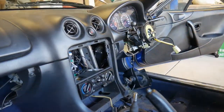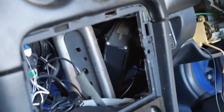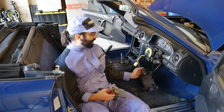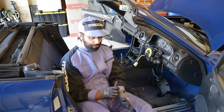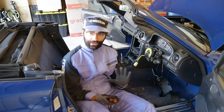The wiring for this cruise control is going to be a pain. If you have a look deep inside the dash, that module just hanging around not fixed in place — that's the cruise control module. I had a quick chat with the owner, and it doesn't work anyway, which makes me really happy because he's given me permission to cut it out. Keeping this thing intact while pulling the dashboard out was going to be a nightmare. A lot of you will find similar issues with MX-5s of this age — whether it's a broken cruise control system or a crappy aftermarket stereo — so it's always good to have a clear exit strategy when things go wrong.